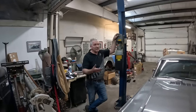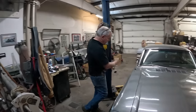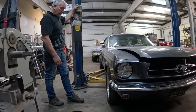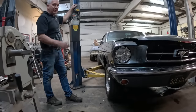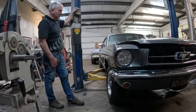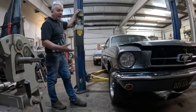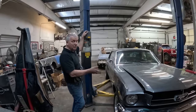We're back on the ground. We're going to do that same demonstration — lifting it up and watching the wheel. We've got the wheel pretty straight — not wheel-alignment accurate, but straight with the four-foot ruler. So just pull it back up in the air and you guys see for yourself. It did go in a little, but nothing like before. On any production car you're going to get a little bit of bump steer, so I'm going to call that a win. That five-plus inches of movement is gone.